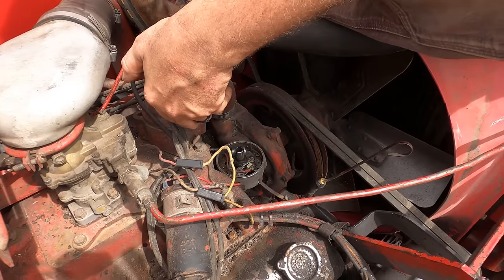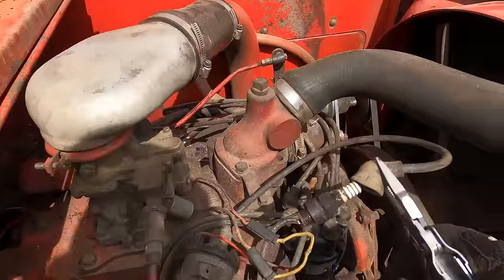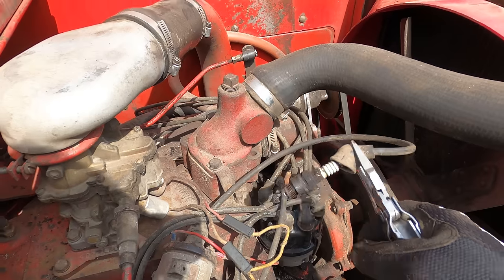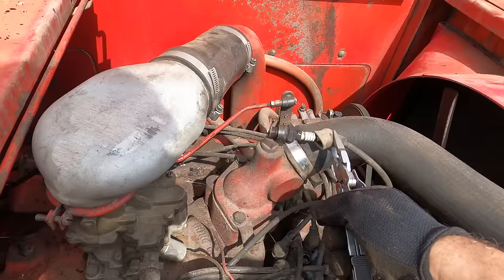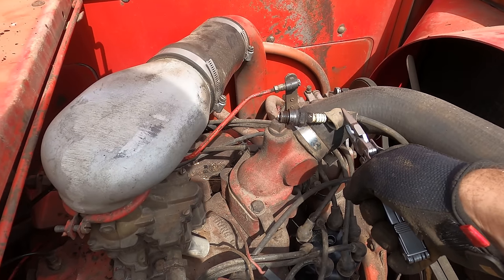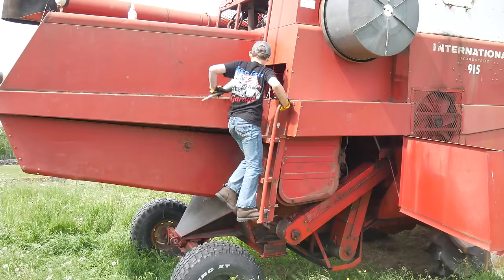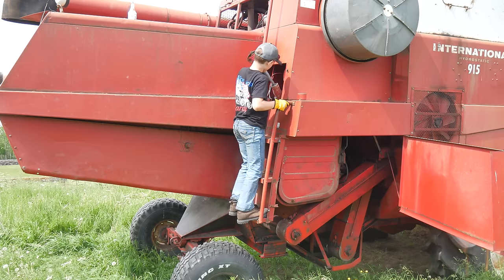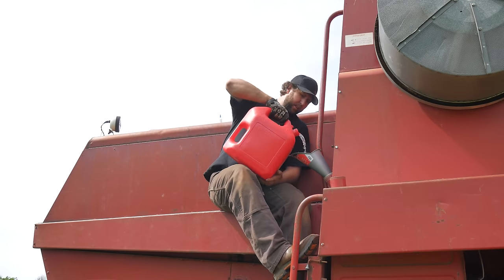Brad's up there in the cab. We're gonna do this the old-school way — I didn't bring much in the way of tools. One of three things is gonna happen: I'm gonna get shocked, I'm gonna get shocked and verify spark, or nothing. Okay, crank it over. Okay, stop. We got spark — all over my leg!